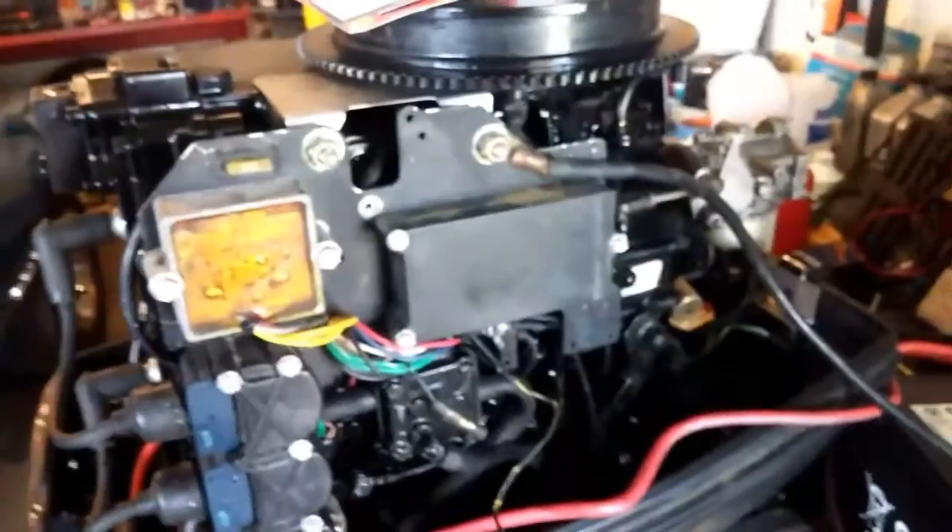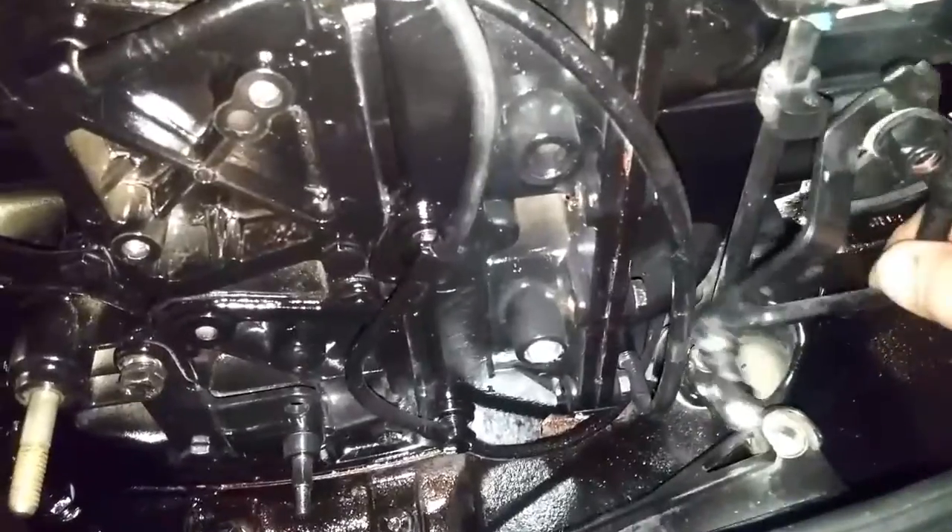Carrying on with the rest of the videos. Unfortunately my last few videos conked out on me. I'll try to retrieve them and maybe upload them later. Anyway, I finished assembling the power head, put the midsection on, and put it back together. Remember, you need to put this linkage on first before you set the power head down, then leave it where you can pick it up and down so you can get the shift shaft into that hole right there — remember that from the first videos?